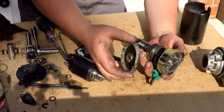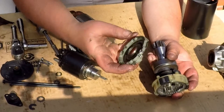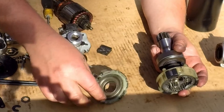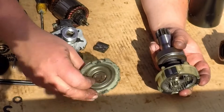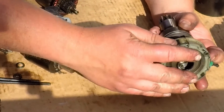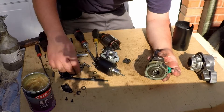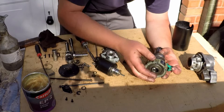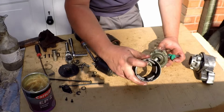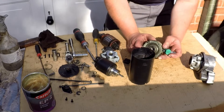This is where the marking comes into place. I took a little bit of a Sharpie pen and put a mark on there, and done the same on this bit. There's a little keyway built into the mechanism so you know which way it goes on - you can just see a little bit of a keyway. These holes also align where the bolts go, which you'll see goes through. That allows it to go on a certain way because there is one little notch cut into it, so it'll only go in one way. These are all little things put into place to help you get it right.